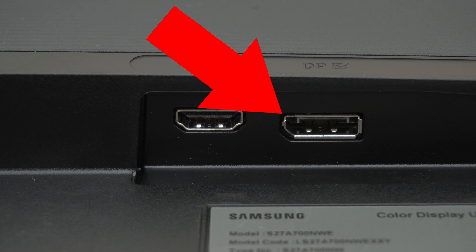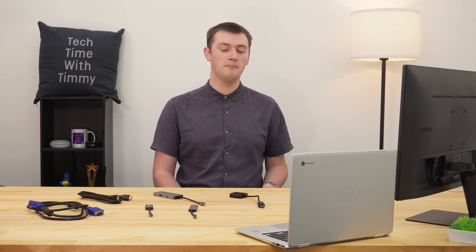These two ports — HDMI and VGA — are probably the most common. If your monitor is reasonably modern, it will probably have an HDMI port; if it's quite old, it might have a VGA port. But some fairly obscure monitors might have a DisplayPort, mini-DisplayPort, mini-HDMI port, or something else. If that's the case, it's basically the same story — you can either get an adapter from HDMI to whatever port you need, or an adapter from USB-C to whatever port you need. Once you've got what you need for your Chromebook and monitor, you're ready to connect it.